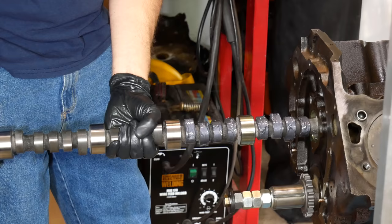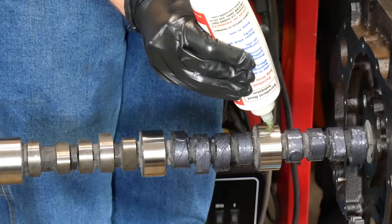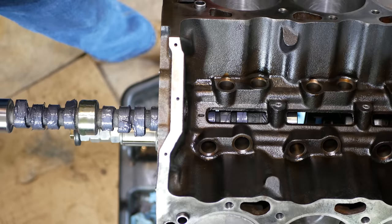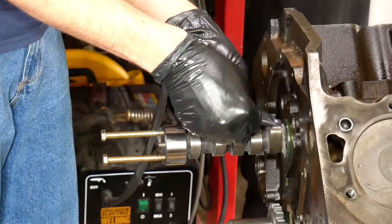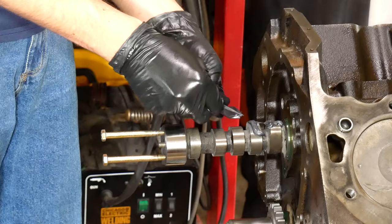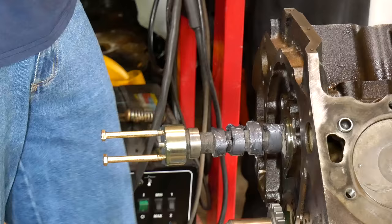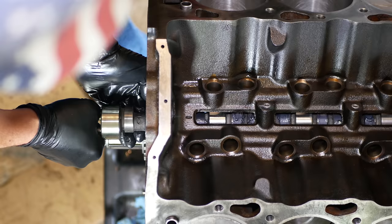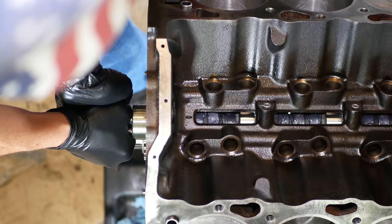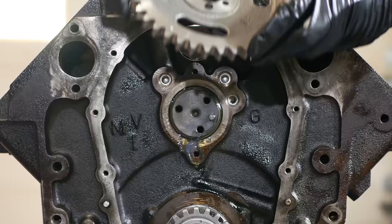We'll really take our time here and do as much as we can to keep from dragging anything across the cam bearing surfaces. Once the first two journals are securely inside the engine block, we'll go ahead and lube more of the cam — giving the next journal and four lobes the same treatment — and slide it in one bearing farther. Then we'll lube the number two journal and get that into place as well. This last one is going to be the hardest and is bound to make some kind of a mess no matter what. So we'll apply some moly lube to the cam lobes and assembly lube to the cam journal. That last lobe towards the front is for the mechanical fuel pump, which this block doesn't have so we don't need to worry about that. Using those bolts for leverage I'll lift up as hard as I'm able to and push the cam towards the back of the block. Finally it all slots into place and the camshaft is fully installed.